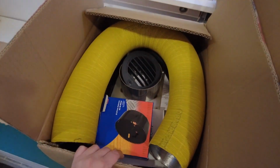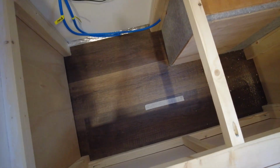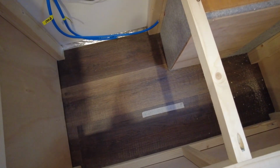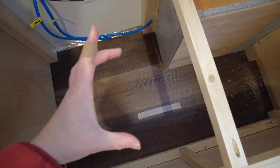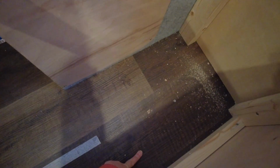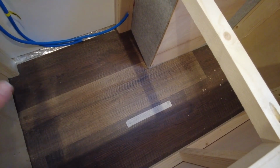So I've got all my parts here for the diesel heater, and the whole setup, including all of the water elements, are going in this space here, which we thought would be quite straightforward. However, there's only very specific places we can put the diesel heater, because it has to go through the floor. It needs a turret this size that's got to go all the way through the floor, and underneath the floor I've got a great big beam coming right across here, and another coming right across there, and obviously the places you'd want to put the heater are there or over here.